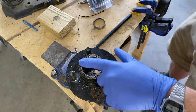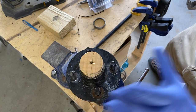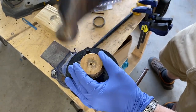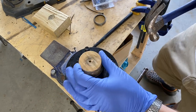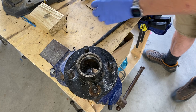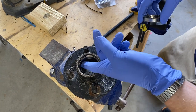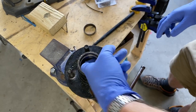You can see it started to go down. I happen to have another block of wood from a separate project that is just the right diameter to push this the rest of the way. We hammer the racer in the rest of the way — that's looking pretty good, a couple more hits for good measure. Another technique you can look up online is to grind down the old racer and use that to drive in the new one. Always check to make sure it's seated properly — this one looks good. We'll do the other side.